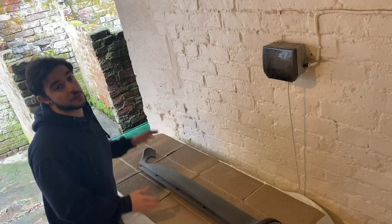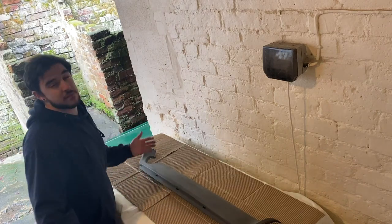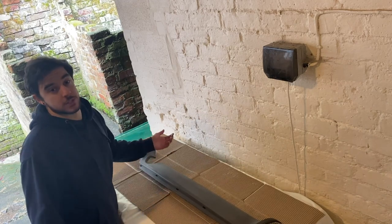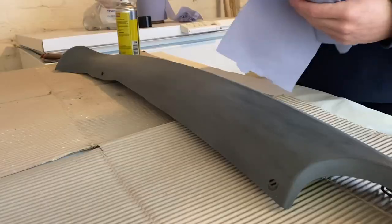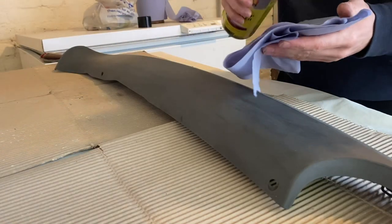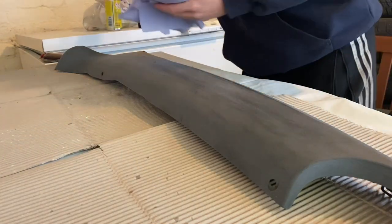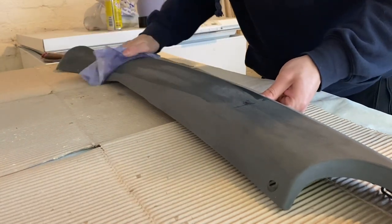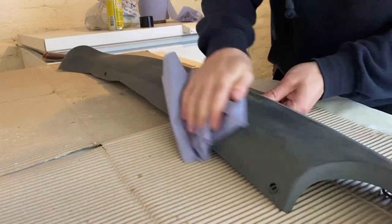All the sanding is done. Thank God, I'm so glad that's over with. I hate sanding — I think everyone does — but I especially hate it because I've just spent the last God knows how many evenings after work doing it. It's now the weekend, but it's finally time for paint. I've brushed off as much dust as I could off these after sanding, and now I'm just going to wipe them down with some panel prep degreaser — spray some on a rag and wipe these down to get any oils from my hands or any last bits of dust from sanding.